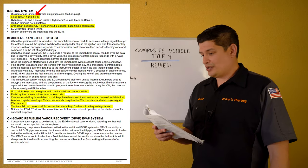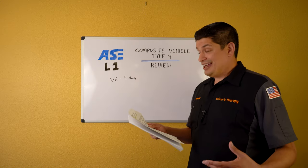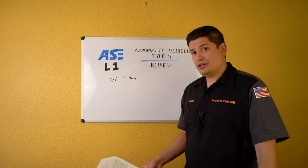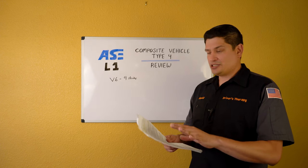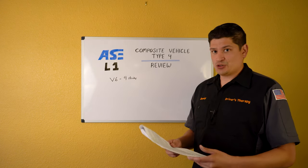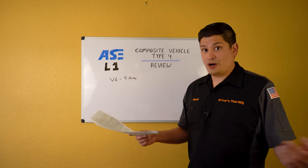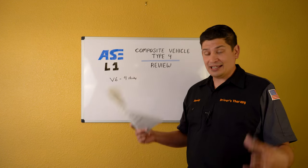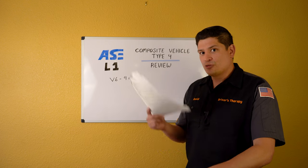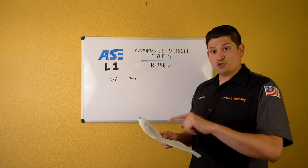Firing order: 1-2-3-4-5-6. The crankshaft position sensor input is used for base timing calculations — that's very important. The CKP sensor is critical: if it doesn't work, the car will not start. It tells the ECM and related systems the timing. Think of it like a watch — if you remove one gear, nothing runs. Without the CKP sensor, it's not working.